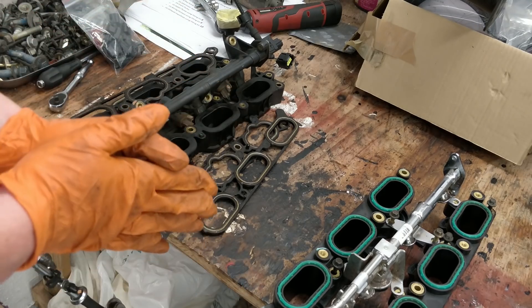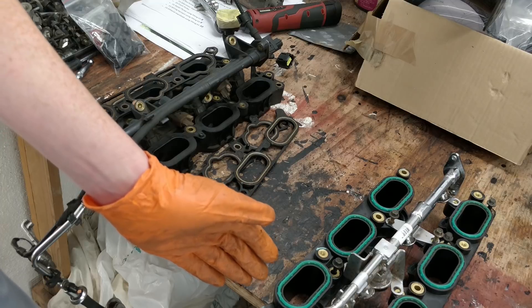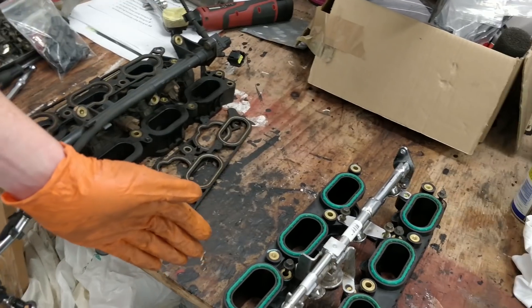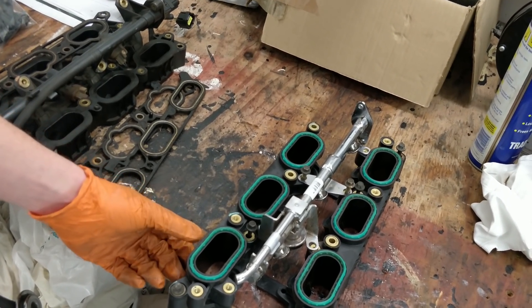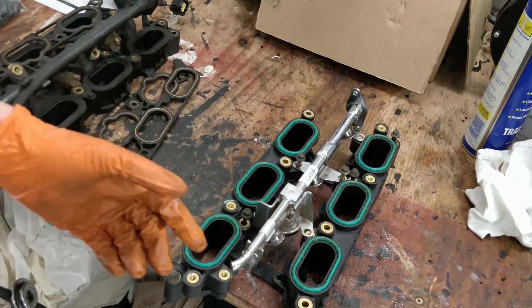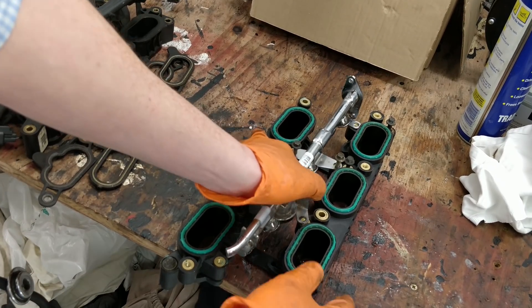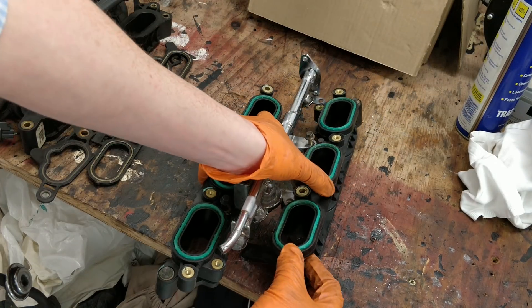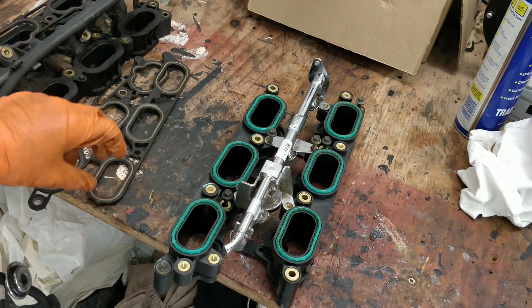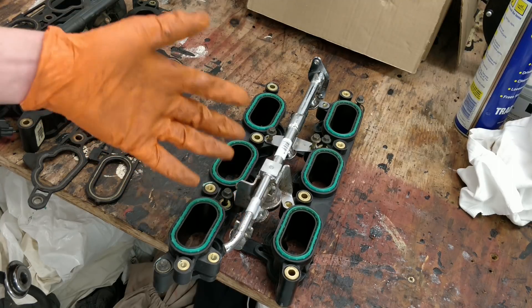What Rocketeer advise is to use a later inlet manifold from a later Jaguar S-type. These have a slightly different design — they're actually taller because the gaskets are integrated into them. You just replace these rubber parts when swapping them out; you can see there's rubber on the bottom and the top instead of a whole separate gasket. They also have a metal fuel rail.